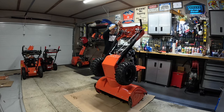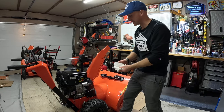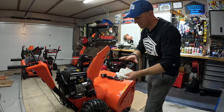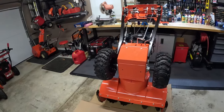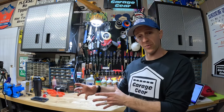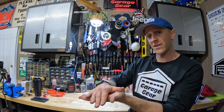I'm going to tip the snowblower back down. While I had this snowblower tipped in the service position, I purposely put some paper towels there to see if any oil would leak out from the tube — nothing. Here are some tips: if you don't want to tip the snowblower into the service position, if you have a car jack low enough, slide it underneath and jack it up a few inches — that should give you just enough space to pull the wheel off. Put a board on top of the car jack before sliding it underneath so you don't bend the belly pan. You could also back the snowblower up onto a couple blocks of wood. All you need is to get the wheels up high enough to take them off.